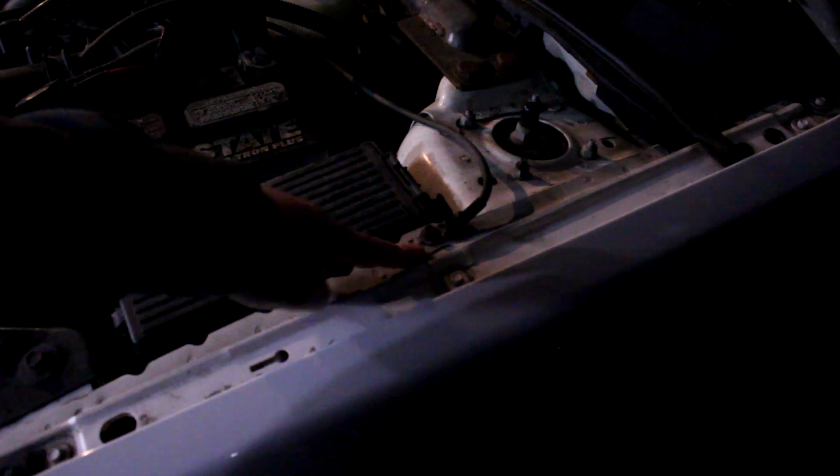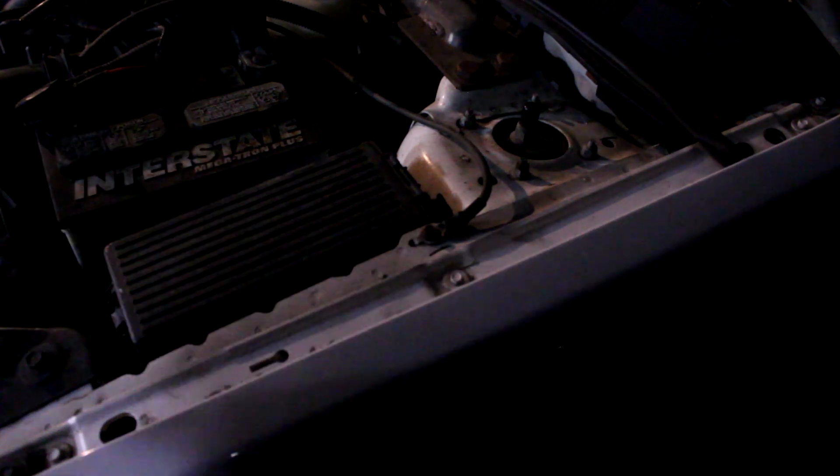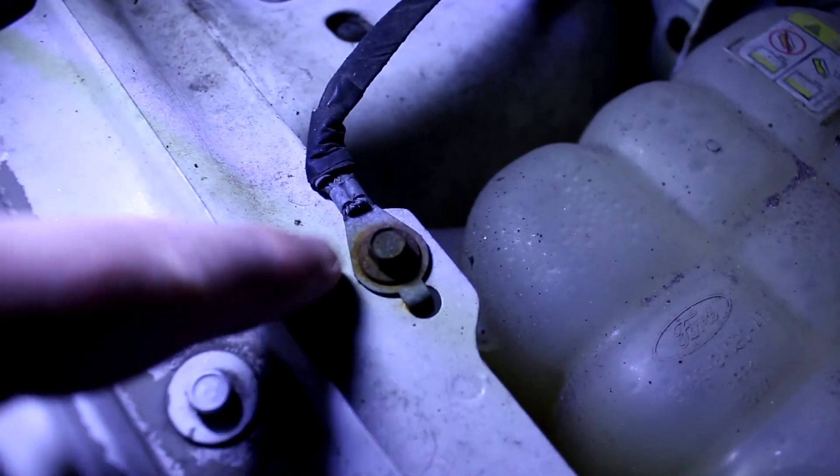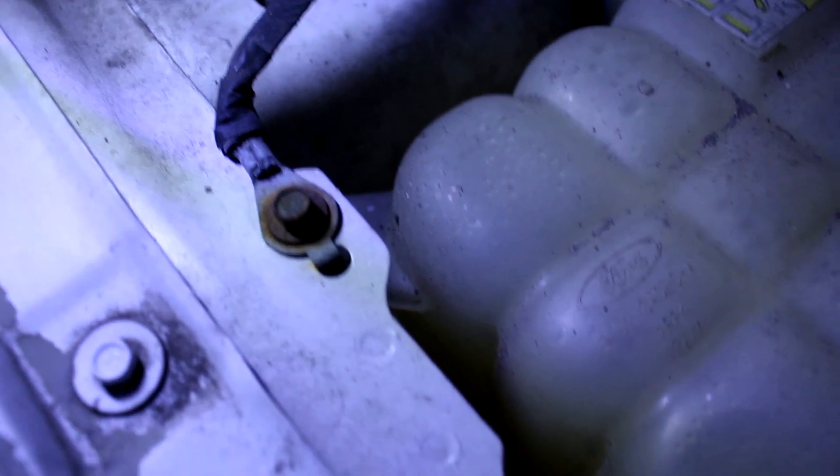Check any ground connections. I'm going to take this bolt off and see if there's any corrosion build up in there — I doubt it, it looks like it's just rusty. Make sure you still have a belt — looks like we do, it's a little hard to see in there but it's in there. There's another one of our ground straps to check; again it looks like it's just rusty, but I'll clean these both up.